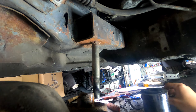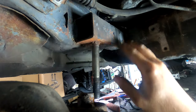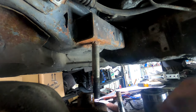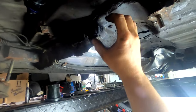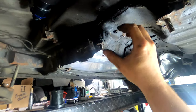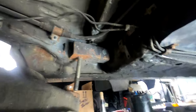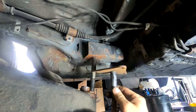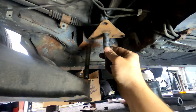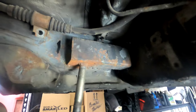My thought process: I've got to cut all this extra metal out of here, grind it all down. We're essentially limited by the drive shaft — it's bolted in here at a fixed angle and position. Wherever this last shaft piece bolts to the diff, that's what we have to work around. We can't raise or lower these mounting points because that will really mess up your rear pinion angle.